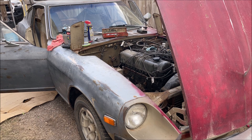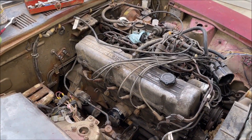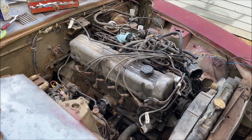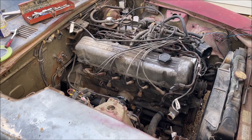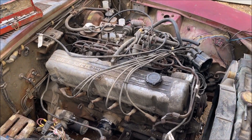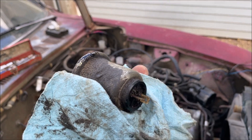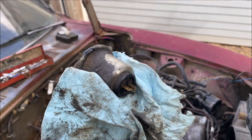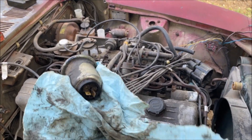Hello, I'm Chris and this is my Z car engine pulling video. This video was going to be starting the car for the first time, but we have many issues. The main issue today is no oil pressure. This is a 78 280Z with fuel injection, and the center two prongs do two jobs: one for the gauge and the other for the fuel injection failsafe — if it doesn't have oil pressure, it shuts your fuel injection off.